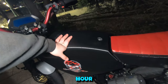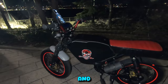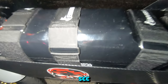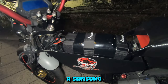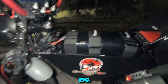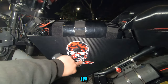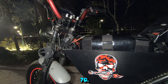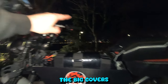The tank fits up to a 55Ah battery from Chai. I'm not sure if it fits the 55Ah from Powerful Lithium since they use spacers in their pack. I'm running a 50Ah pack from Powerful Lithium — it's deep in there but it's been amazing. The rated amps for this pack is 150A; it's a Samsung pack, more of a range pack. I'm actually running 190A — I spoke to VV and they said it's perfectly fine as long as you're not cutting off. I'm running a Far Driver 5302 72V controller and so far I can hit 67 to almost 70 mph. I'm trying to get to 75 but might need more amps.